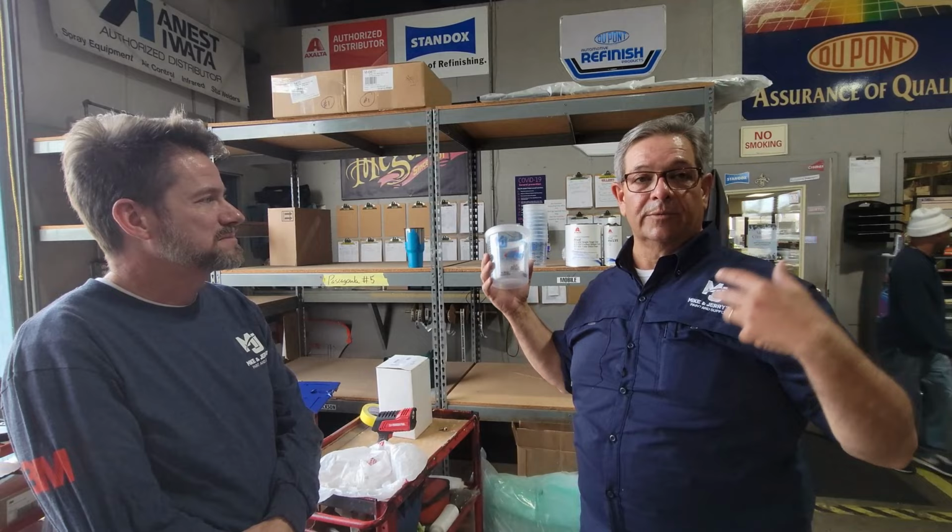All the Imron products are designed to dry very slowly, to cure very slowly, so that it'll all lay down and be flat. You have to understand that this is what they use at truck factories to paint these big trucks. Most of these truck factories have heated paint booths, so when they walk out of the booth after finishing the job, they basically push a button. The heat comes on, bakes it for 45, 50 minutes. When it cools off, it's ready to go back over the line and get work. Bel doesn't have that option, so we put accelerator in his paint. It's good for 2 or 3 weeks before it actually literally wears out the accelerator.